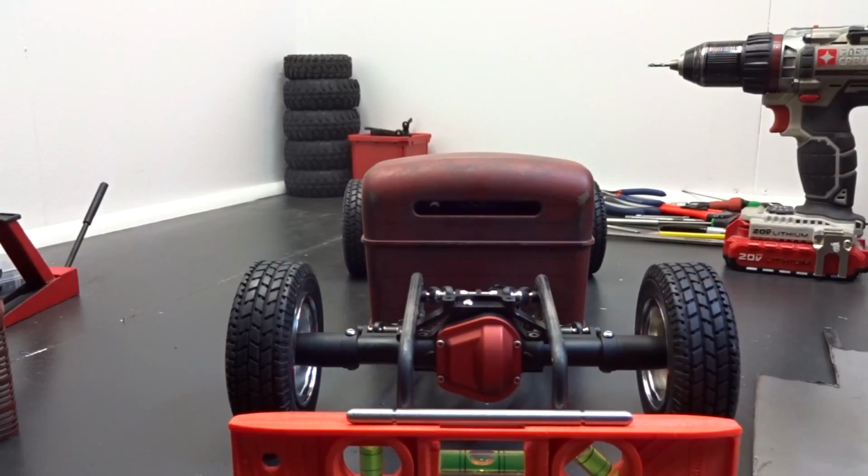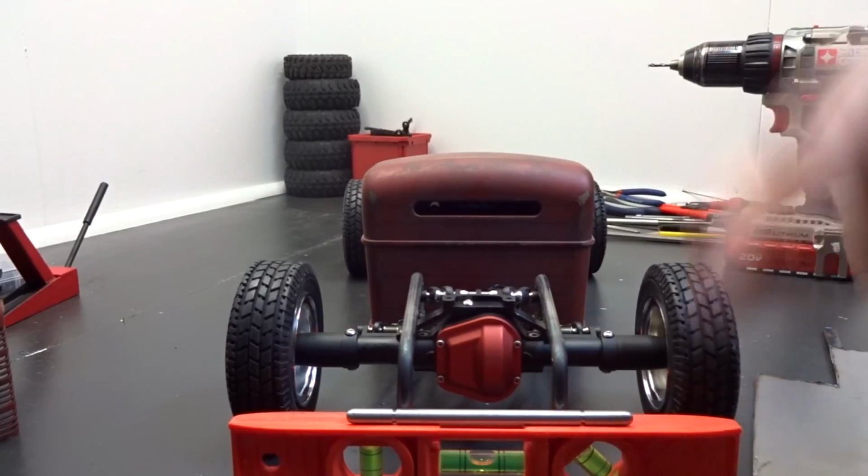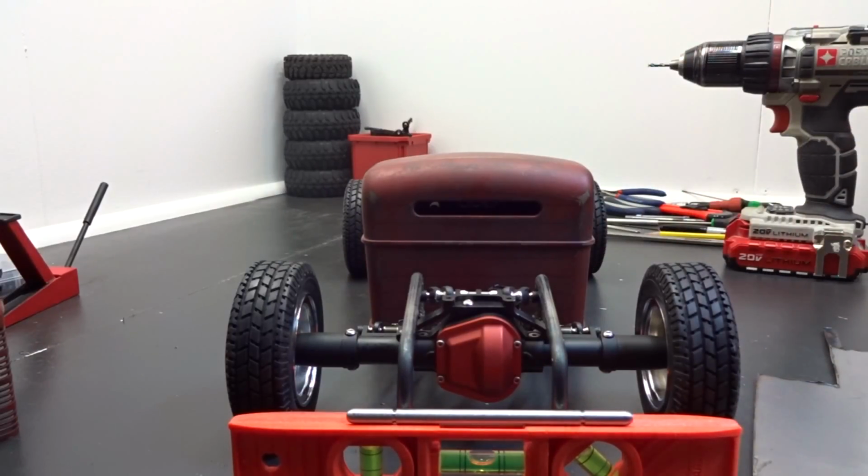Normally when they C-notch something, like I said in the other videos, it's usually 1.5 inch by 3 inch rectangular tubing they'll build it out of, almost like a frame rail but boxed. It has all 4 sides. Or some people will do something custom out of 1.5 inch, or maybe 1.75 inch, round tubing. But it's just not there. Besides the fact that it's going to get covered up with a bed and all that work is really not going to be seen, it's just really not necessary. The room's just not there.